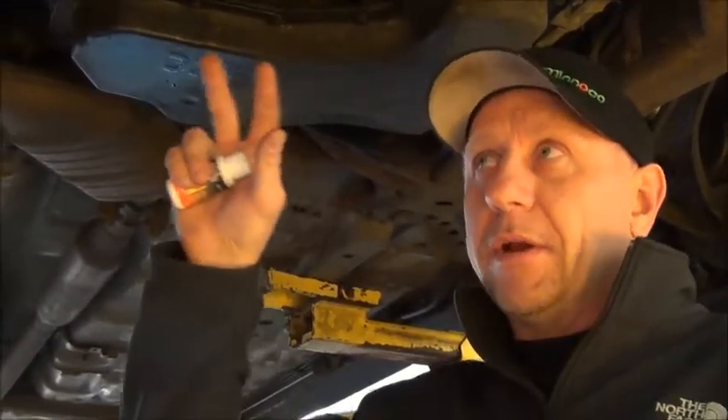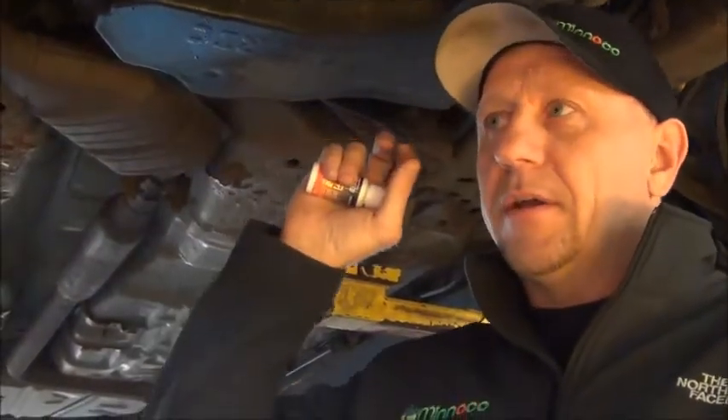The reason we do that is because on an engine like this, there's more than one area it can be leaking from. You have the valve covers, the intake, oil pressure sending units, the oil pan, the drain plug — literally 10 or more places it can be leaking from. A lot of times you'll have more than one leak; you might have a valve cover gasket as well as an oil pan leaking. We want to make sure we're focusing the money on the leak that's the main cause, because we don't want to put money towards something that's not going to fix anything. We're after fixing a leak that affects fluid level or is getting onto a component that could damage it.